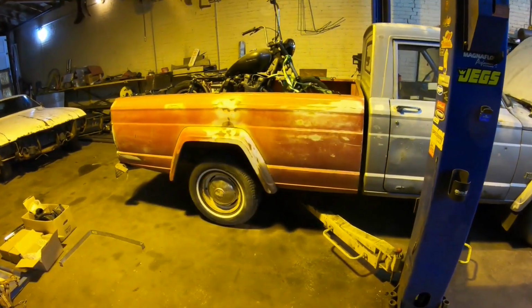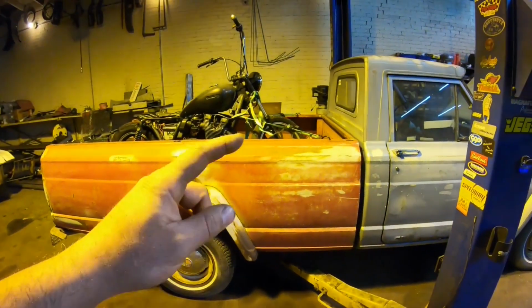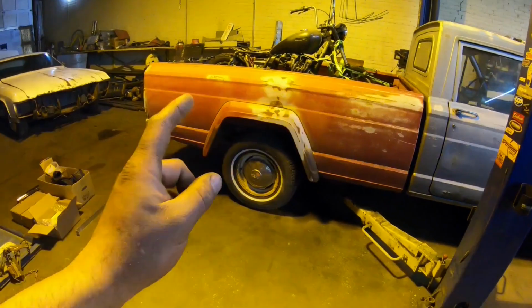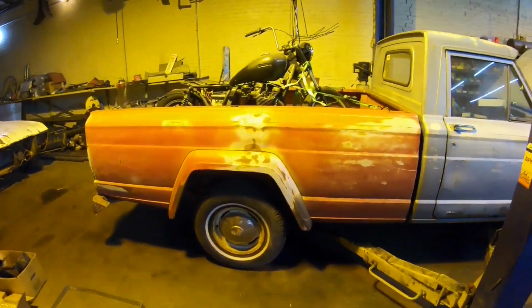We're going to do the gas tank first, the fuel tank. Right now it's currently hanging on one strap, the other strap is here on the floor, and there is nothing connecting the filler neck to the fuel tank underneath. So we're going to seal that up first, just in case I got to use the torch to remove any bolts or anything under the bottom and the back for the wheel cylinders or anything like that. So let's get this thing up in the air.